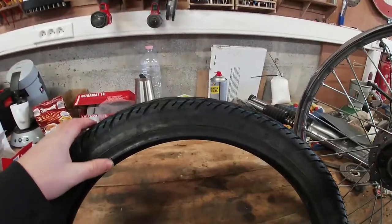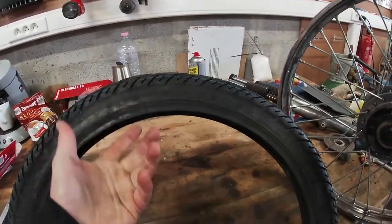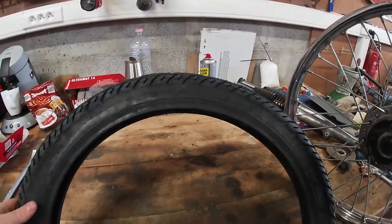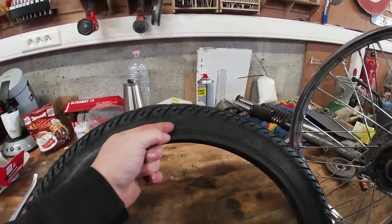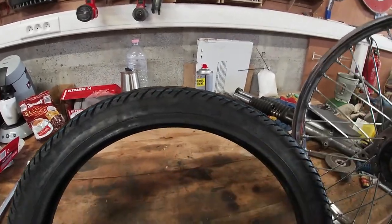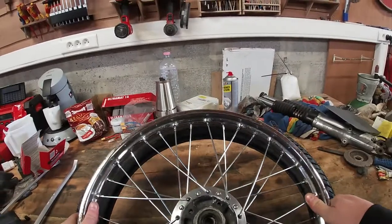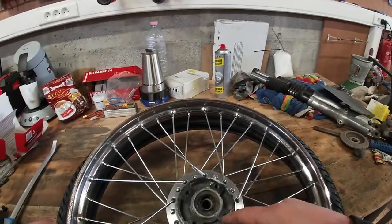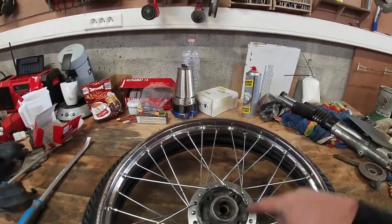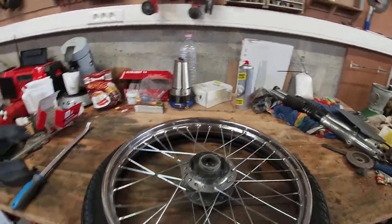Always make sure to check the direction of the tires if you have directional tires. If you have bi-directional then it doesn't really matter, but in this case this is the front. This is the moving direction when you're driving. The disc for the front brake is at this side. I checked on the black RD-50 and if we mount the tire like this, that will be correct.